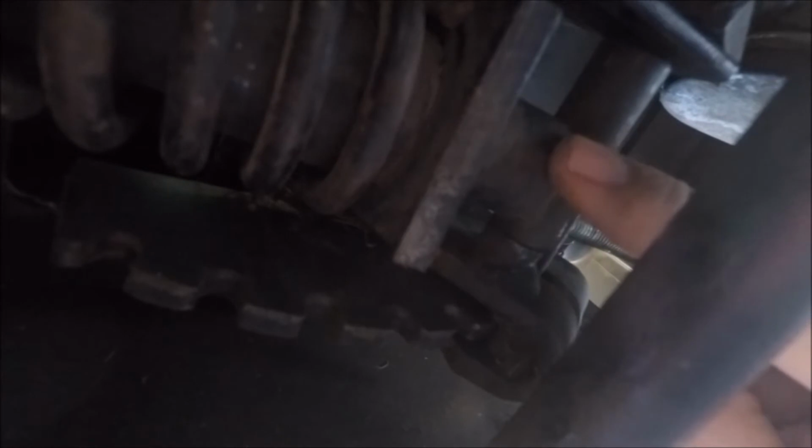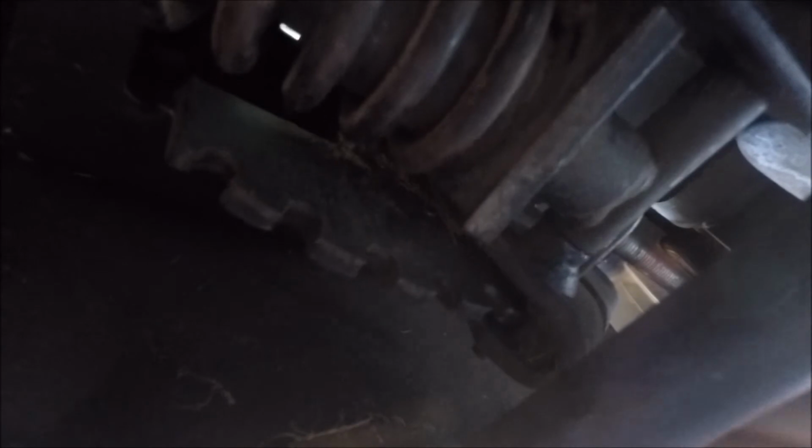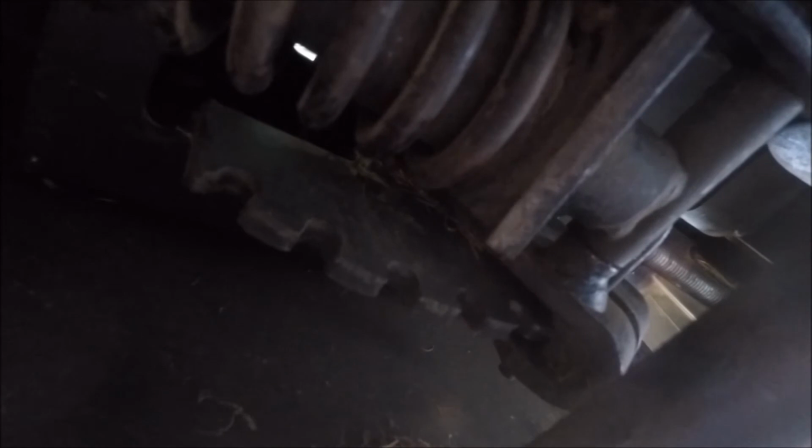One of the things that hung me up for a little while last night when I did this was the orientation of this part of the spring assist. When I initially put this in, I had it flipped 180 degrees and it went right in up here, but when it came time to go back here and install the spring onto the anchor pin, it just wasn't going to happen. I've seen some forum posts that said that they used a C-clamp to put it on there. I don't think those people realize that they might have had this front part up here oriented the wrong way. As soon as I flipped it over, everything went right in, but I wasted probably about 1/2 hour trying to fight with this thing, trying to figure out how to get it together. But after that, it wasn't too bad.